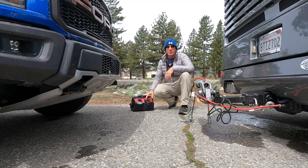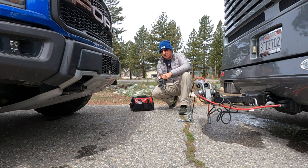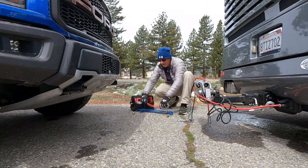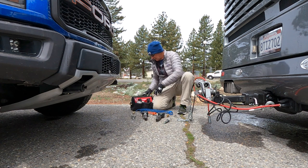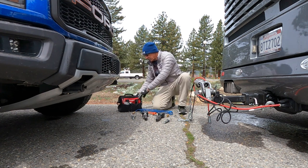This process is really pretty simple — even on a bad day it takes me just a couple of minutes to hook this up. You can get one of these little Husky bags from Home Depot, and it keeps everything neat and secure all in one place. I usually store this in the back seat of the truck so it's always right where I need it. I have my airline, my emergency brake tether, my tow hooks, and my two tow pins. That's all there is to it. I'll take off my rubber protection tip and stow it right in the bag.